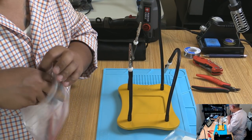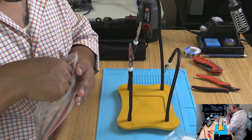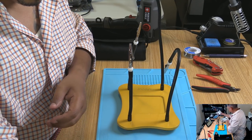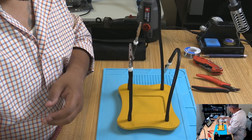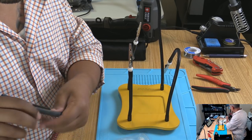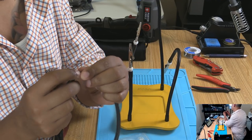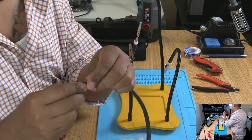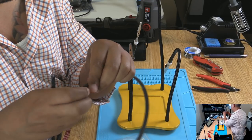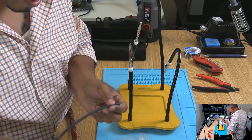or TightFlex in this case, I think they call this one TightFlex, the weaving is a little tighter on it. I'm gonna have to go with the quarter inch shrink tubing, because it needs to fit over the TechFlex now, which is a little too close for comfort if I want to put this weaving over it. This is going to be really fun. Just going to do a quick dry run to make sure I can actually get it in there. Yep, I can. Cool.